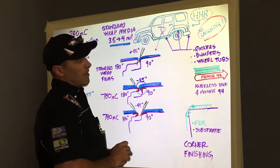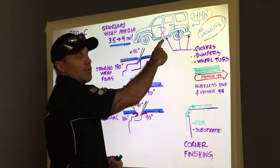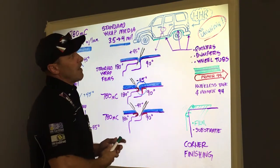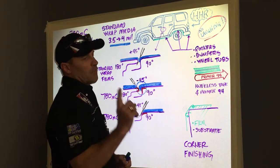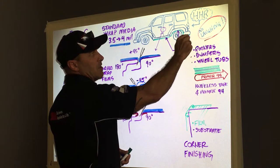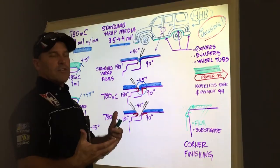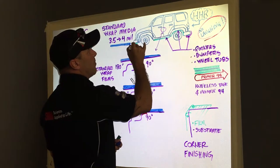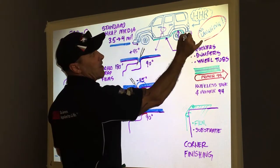Now I want to talk about finishing off the lower portion of the vehicle. In the Midwest, we have salt spray, salt sand, and harsh environments, so anything we can do to lock down the bottom side of a 780 wrap application is going to be of benefit. I'm going to ask you to fortify your application by doing two things. First, start utilizing 3M's knifeless product for making long cuts along the rocker panels, in the wheel tubs, and on the bottom side of your bumpers. Because the 780 is so much thicker than a standard film, don't try to reach the nether regions of these bumpers with the film — just stop just below bottom center, out of sight, to make your cut.